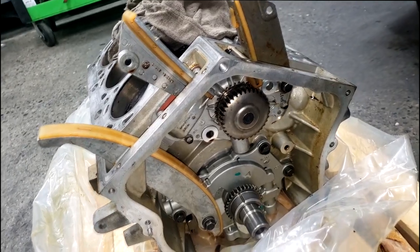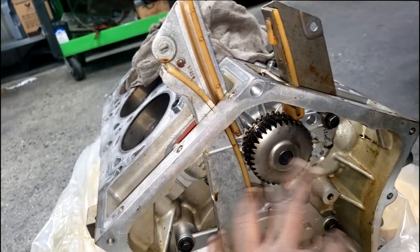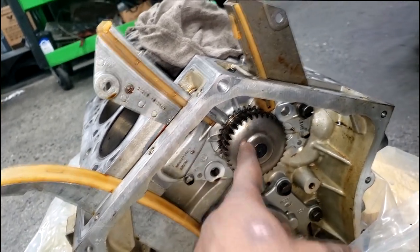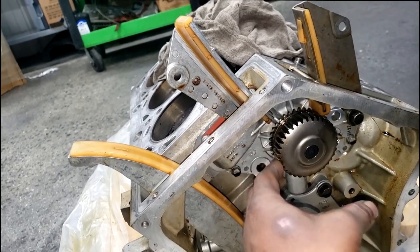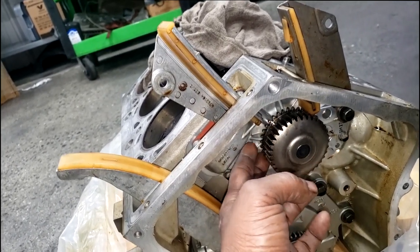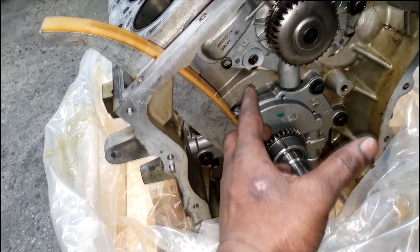That's where we stand on this one — they had already disassembled it. The water pump — notice the water pump is in the chain oiling/cooling area. In the event this water pump leaks, there's supposed to be a weep hole that goes outside the block. But what if the water pump was rupturing inside? What if it just came apart? Especially those cheap aftermarket water pumps — when they fail, they can cause catastrophic failure. Even Mopar water pumps will come apart internally, so coolant gets in. If coolant dropped from the water pump housing down to the oil pan, coolant ends up in the oil.